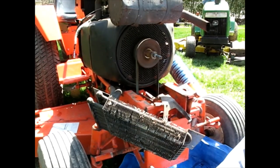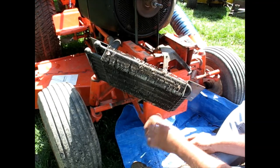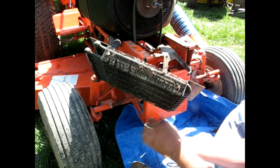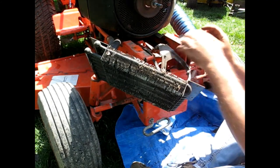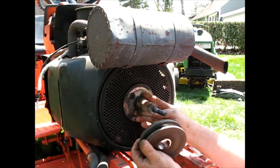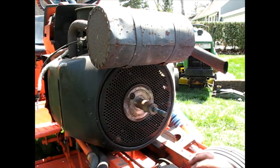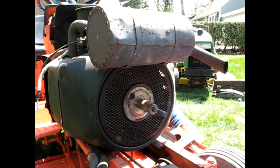What I'm going to do now is down here — this is how you tension your belt. When I release the tension off that belt, it just comes off. Look at all these washers, wave washers, the whole lead macaroni. Here's your clutch lining material — looks like I've got a good amount left on this one. Looks like a pre-stripped number three Phillips times three, and a couple of hex bolts are holding that on. I'm going to start with the Phillips.